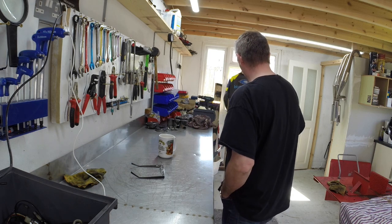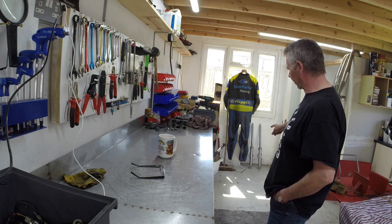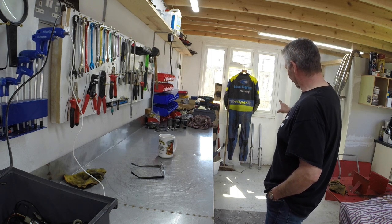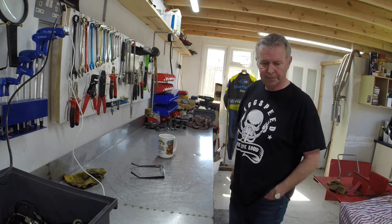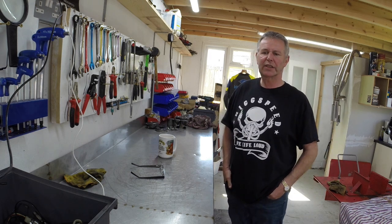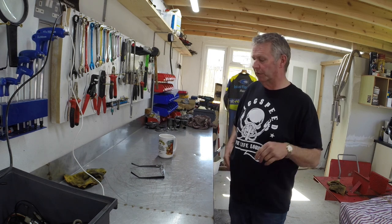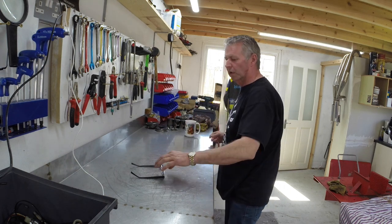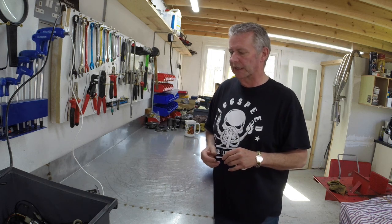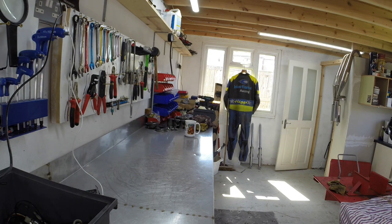Wheels are completely finished now. Oh, the forks are completely finished. The forks are done, vapor blasted, scotch brighted, clear lacquered, polished up, all new seals, new oil, all that kind of stuff. That's all done, so you'll get to see that when it goes back together. I'm still waiting for the zincing, which is probably the biggest thing I'm waiting for at the moment. So what I'm going to do while I'm waiting is start on the crankcase and try and put most of the gearbox back together.